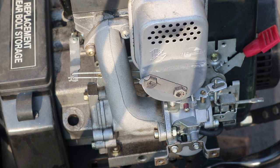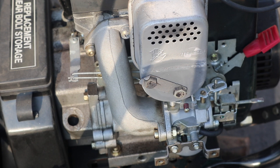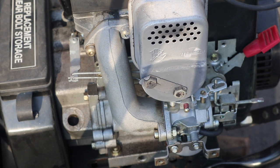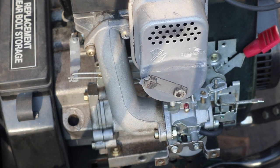I'm going to turn on the snowblower and use the tachometer to measure the idle RPM. I'm going to set it to 3600, then test what the RPM is when I use the auger — the RPM will drop. You don't want it faster than 3600; I believe some people set it a little below 3600 because these engines are not meant to go that fast. So more speed is not better in this case.